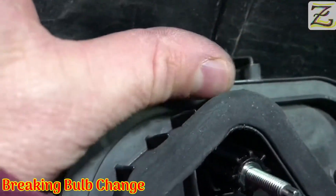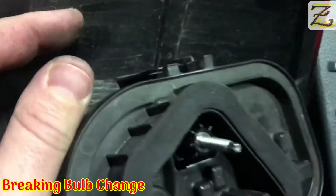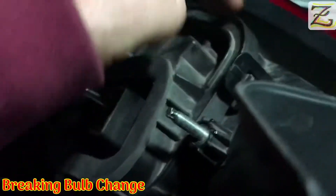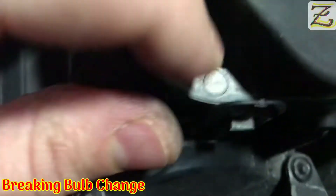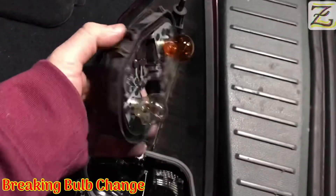The best thing is to take this one out — the one that is alone. Now you can see it's out. Then try to lift a little bit — now it becomes loose. Now extract those two carefully so you don't break them — one and two. Just keep pushing off. Sometimes the second one here is a little hard, a little tricky. You just have to be patient pulling out. There you go, and hopefully you haven't broken it. Now it's out and as you can see there are two bulbs — this is the bulbs and this is the bulb container.